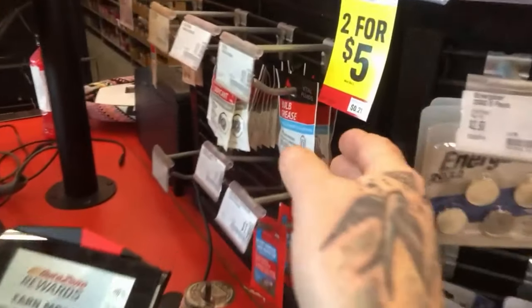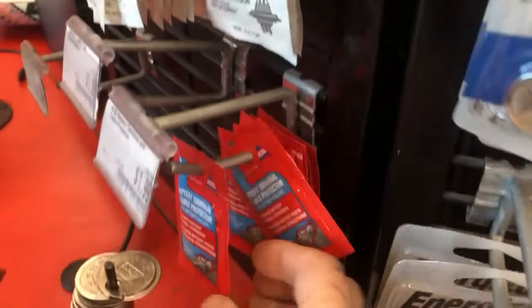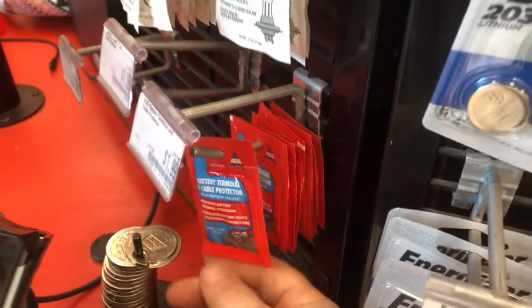And you might want to throw on a little bit of dielectric grease on that fuse, your connectors, even your battery terminals. That'll go a long way from staving off problems like that. If you don't want to get a big can like this, you can just get those little packs of light bulb grease that they sell at the auto parts store by the counter. Same stuff. Speaking of battery terminals, that segues us into problem number 4.